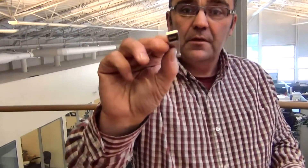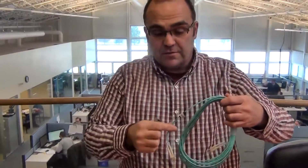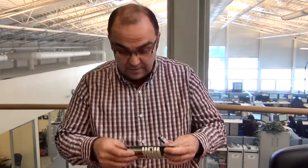This is a typical transceiver. What the transceiver does is it takes the light pulse from the fiber cable and transforms it into an electrical pulse so that the actual NIC card can use that pulse from the fiber connection to communicate with the motherboard and understand what data is going through.